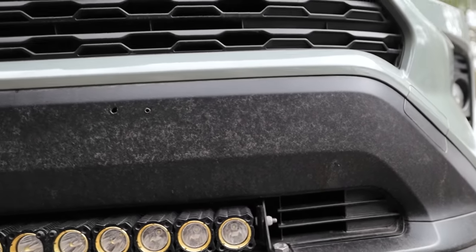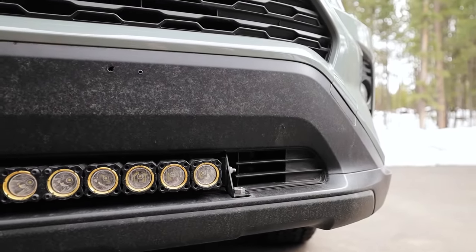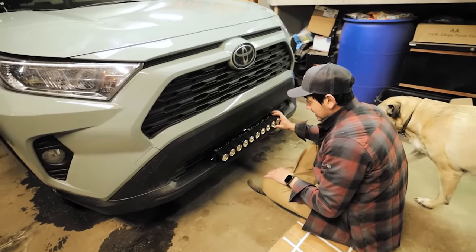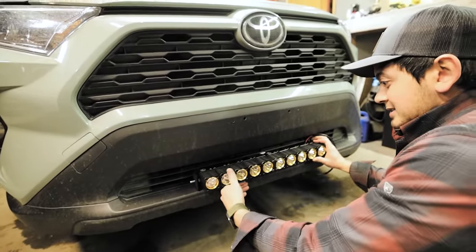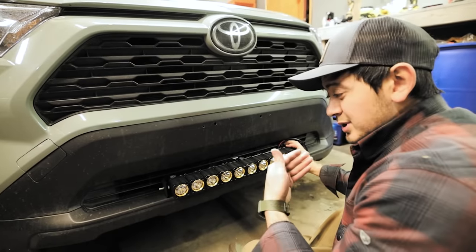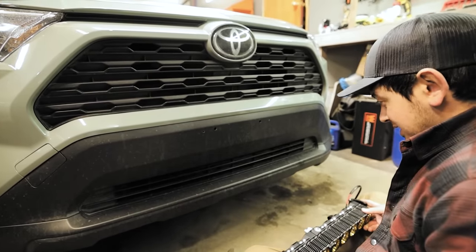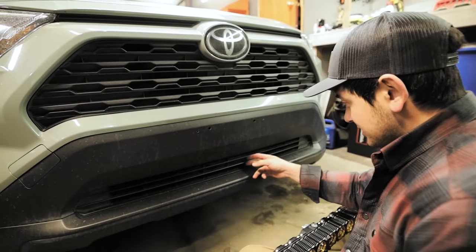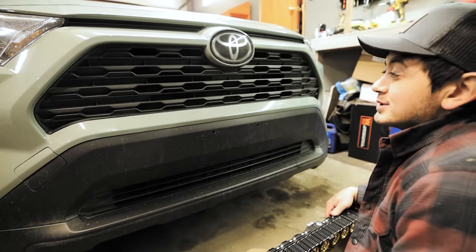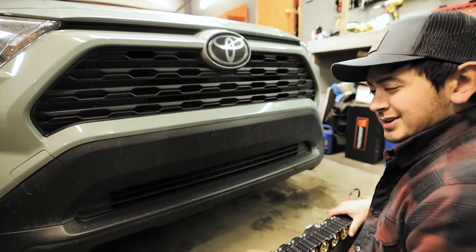It fits into this lower grille area really nicely. It was like this all the way across — I just got some tin snips and those things cut very easily. That is a permanent modification unfortunately, as that grille area isn't just removable in and of itself. I probably would have taken the whole thing out otherwise, but I cut it out. We want to mount this in here down low — it fits nicely in the spot, but it sticks out. I don't want this to be the thing that protrudes the most out the front, because if Ashley pulls a little too close to a building she'll smush this. So we cut the grille out to mount the light bar a little further back in here. The radiator is behind here so we don't want to block too much airflow, but this still allows quite a bit of airflow above and below it, so we should be fine.